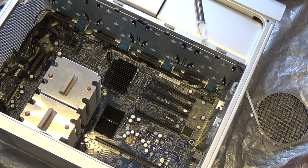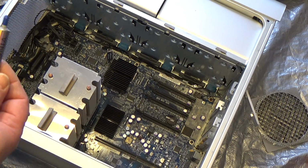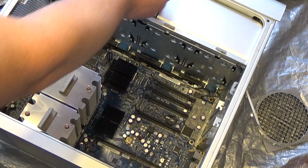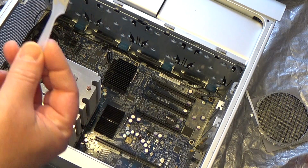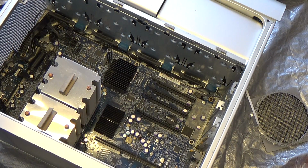The screws and bolts are stainless steel. Got my thermal paste on there. This thermal paste actually came with a little applicator too, and that'll probably clean off most likely. Insignia thermal conductive compound is a grease-like silicone material heavily filled with heat conductive metal oxides. This combination promotes high thermal conductivity, low bleed, and high temperature stability. This compound resists changes in consistency at temperatures up to 572 degrees Fahrenheit or 300 Celsius. It's basically silicone and little metal particles.